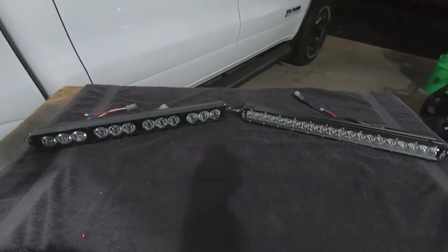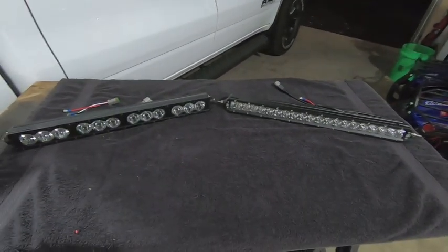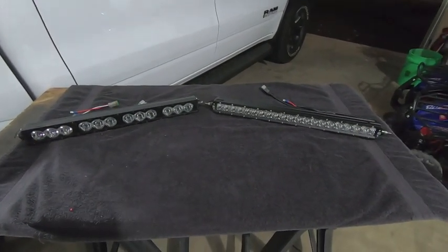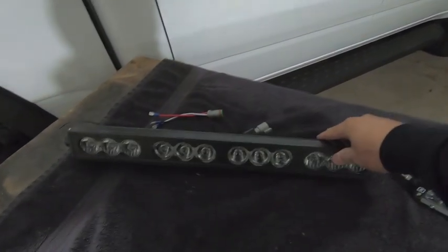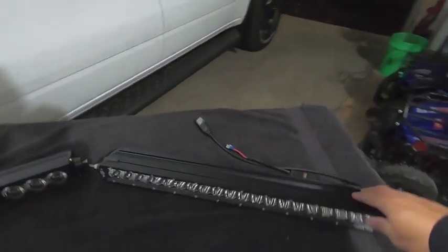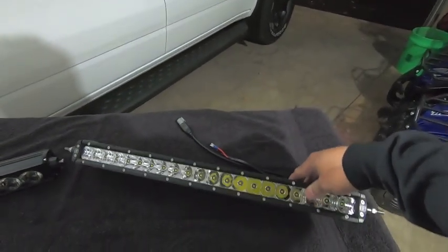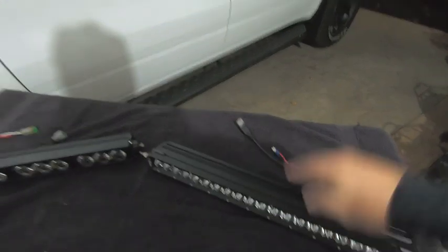All things considered, the Z-Roads won almost by a factor of 10 over the OZ light bar. The OZ's lenses try to guide as much light downward, reducing upward waste, but it does have a slightly patchy light output. The Z-Roads uses the housing itself to direct light — solid in the center, rippled on the edge — giving a very consistent spread in front. However, because there's nothing on top of this light bar, it also kicks light upward, potentially wasting some lumens that better lensing could have redirected downward.